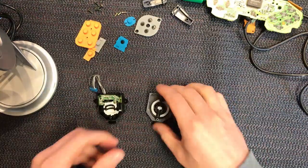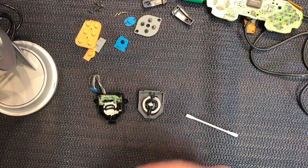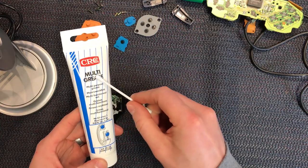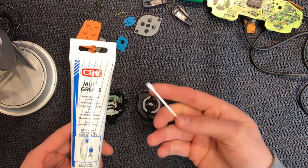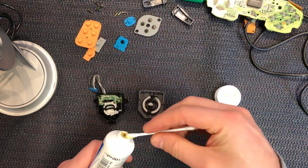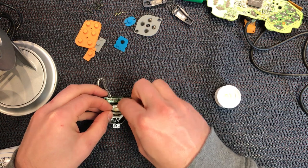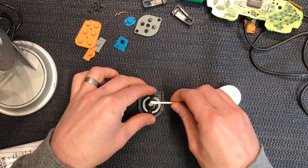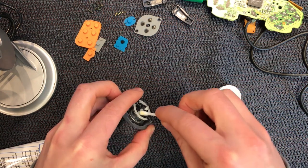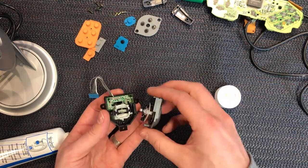I've grabbed the joystick part from outside — it's all set and ready to go. One last optional but recommended step: put some grease on these parts to stop them wearing out again. You just need a really small amount of grease on a cotton tip. Rub it inside on the bowl and on those carrier pieces, definitely on the end of the joystick now that we've extended it a little bit. A little bit on the gears themselves too, and then let's put this back together.